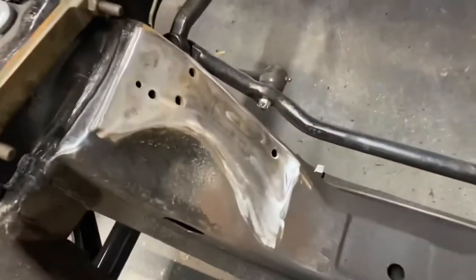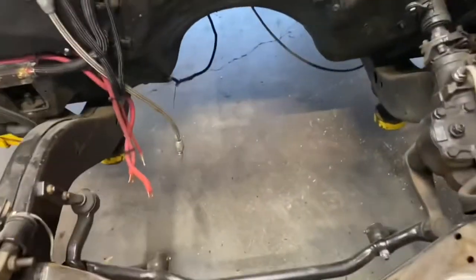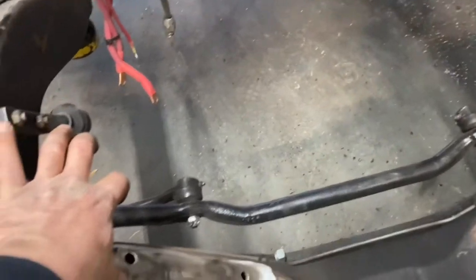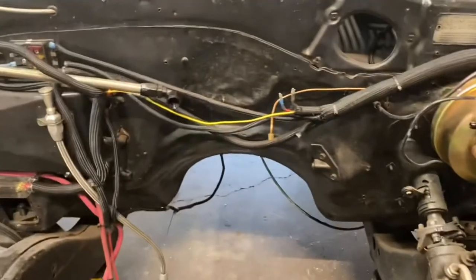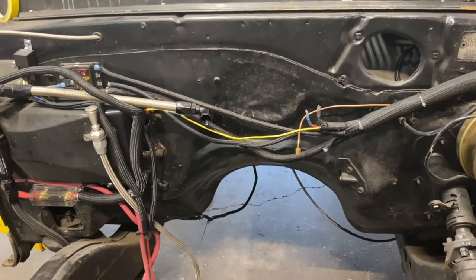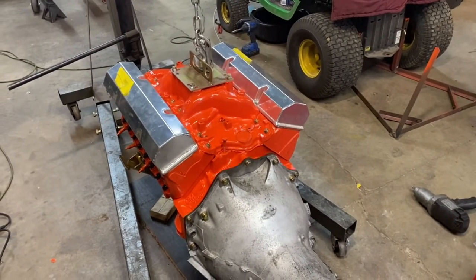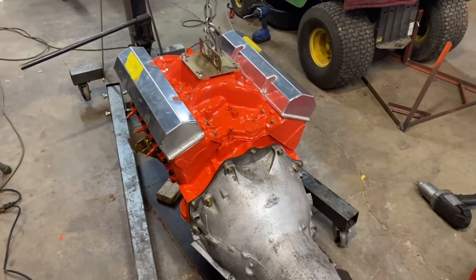I went after the chassis and cleaned up where I know I'm going to be welding. Probably going to have to build off the back side of this chassis and gusset it up from the back, because this mount is going to hang all the way over. We'll need to clearance our transmission tunnel a little bit. Being that we're running this adapter plate puts those top bell housing bolts really close to the tunnel. The issues we had before with the front of the engine being too high and having to shim the back of the transmission up to get the proper driveshaft angle made that problem worse. Hopefully this will be a lot better once we get the new mounts and the engine sitting lower in the engine bay. We'll check back in.